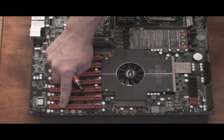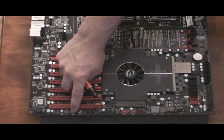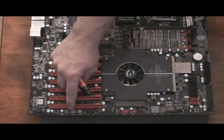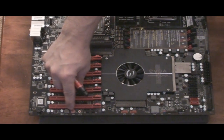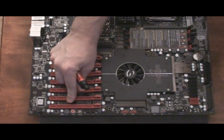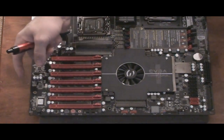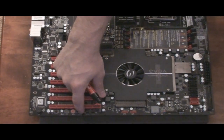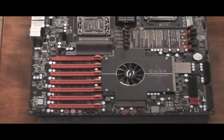With this board being so big, a lot of people may build it outside of a case, so these are convenient. This is a reset and a power button, and there are LEDs in these as well. In the reset button will be the hard drive activity LED, and inside the power button will be the power light. Next to it you have a CMOS clear button, so if you do some overclocking and it doesn't work and you need help with the post, you just push that down and it resets your BIOS settings.